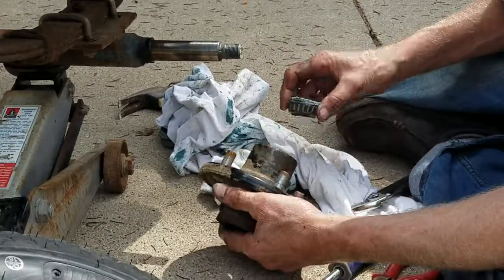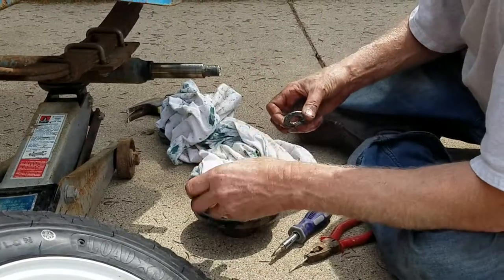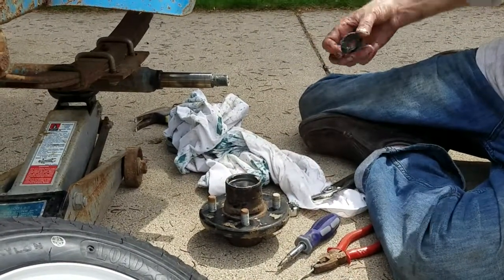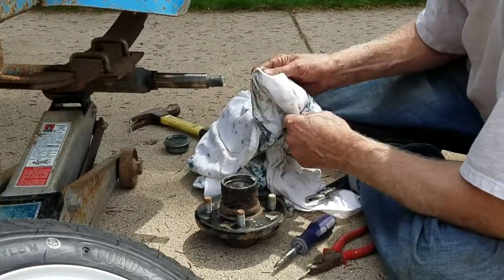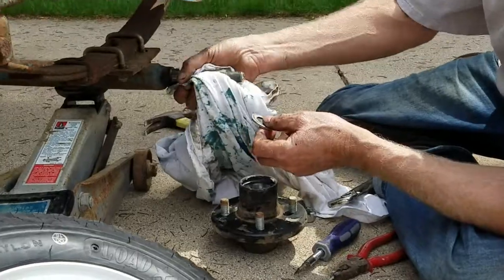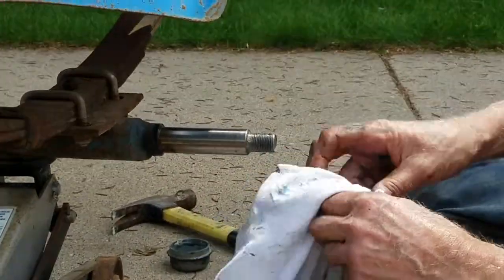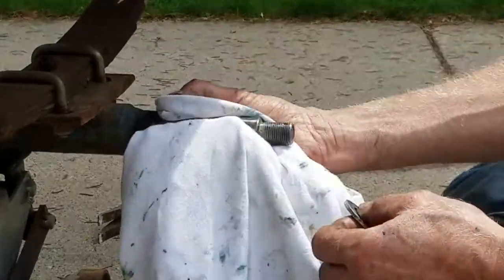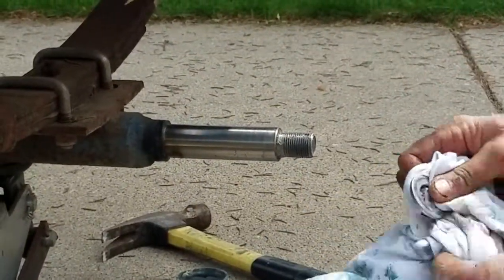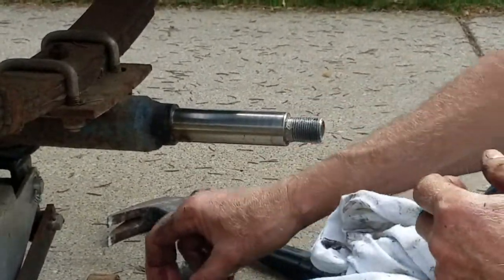And this one here, a washer. So there's a washer to the outside? Is that right behind that nut? Yeah, there's a washer behind that. This actually looks pretty clean. And you want to make sure that's nice and smooth and clean, or you have an issue there. If there's any burrs or anything on there, it's best to just file them off. And just make sure it's nice and polished clean.